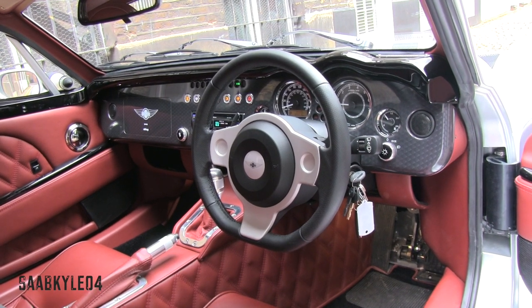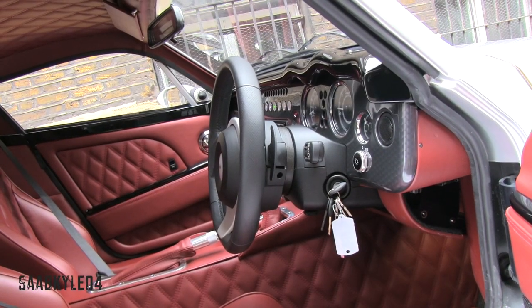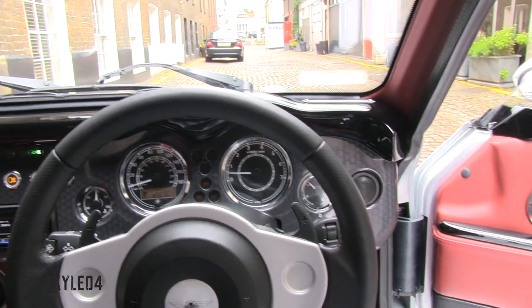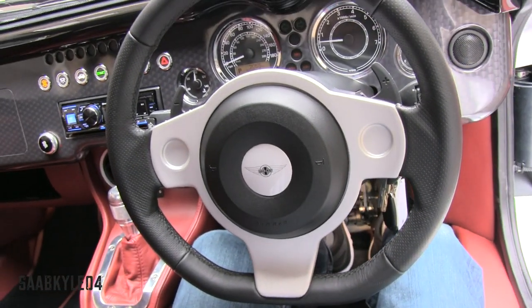The Aero Coupe features an electro-hydraulic variable ratio power steering system routed through a small diameter 3-spoke flat bottom steering wheel. It's wrapped in hand-stitched leather with perforations to either side and silver trim surrounding the airbag cover. It takes 2 turns to lock and has a 32-foot turning radius.